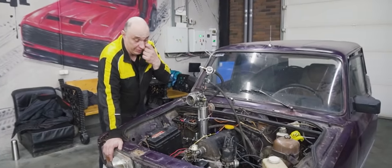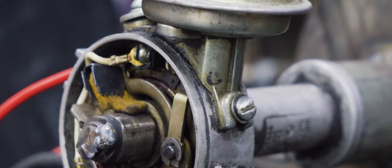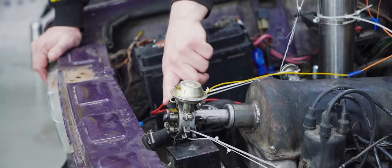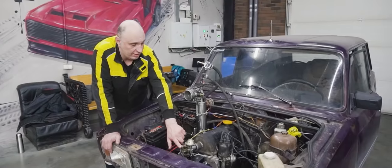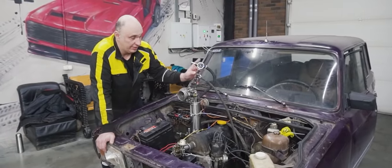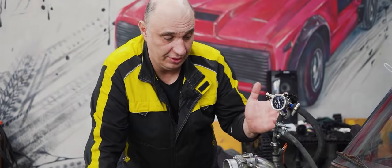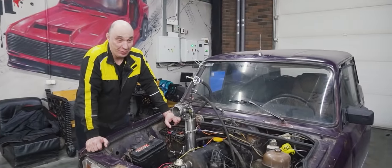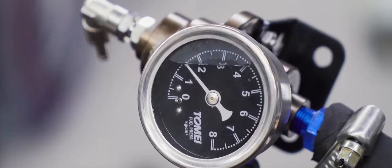Oh yeah, and one more thing. When it's switched off, the motor can potentially assume any position. It very well might happen that it'll be sending a constant signal to the injector, which will result in it being stuck open. In order to prevent that, we've installed a button that you have to press to power up the system for the whole thing to run. Right, I say we try this out. We won't find out how it works until we do. Does anybody want to go do the honors? Let's do this. Let her rip.